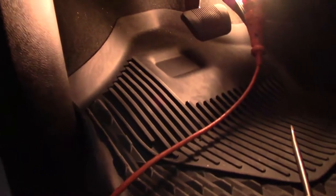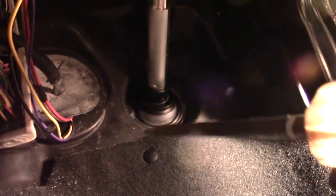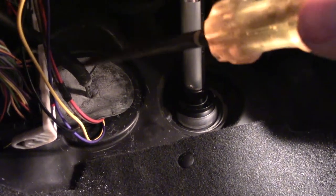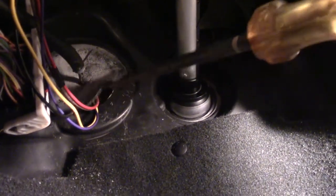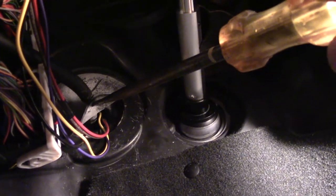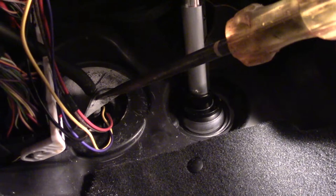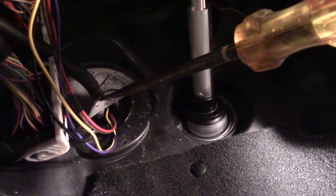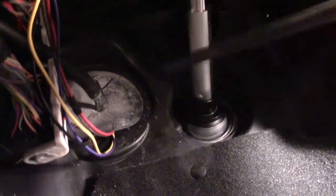On this vehicle it's really easy to do. You have the brake pedal, and if you follow it up into the firewall, you see this is the steering column right here. Next to the steering column you've got this rubber boot, and coming out of this boot is the parking brake. So all you do is you pick up this boot right here, and you push through that rubber grommet — cut it with a knife or something — and you're able to slide your wires through. Extremely easy to do on this vehicle.